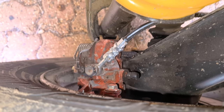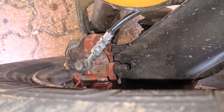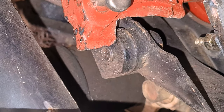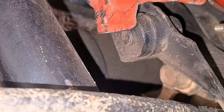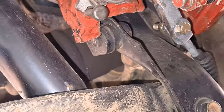Before we go further, I want to explain something — you're going to see me cut into the caliper shortly. I mentioned I mounted the bleeder upright, which is not the standard mounting per the instructions for the rear disc conversion brackets. What it requires is coming down to the caliper where the handbrake cable is normally retained and cutting that entire bracket off. This causes clearance issues with the trailing arm. Either way you have to trim the trailing arm, but if I was going to cut into my trailing arm I wanted to make sure it was worth it and not doing it for a bleeder mounted upside down.